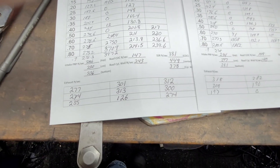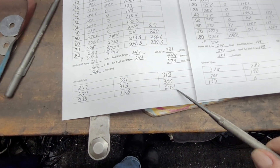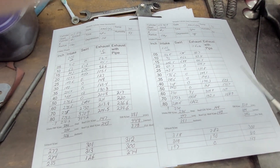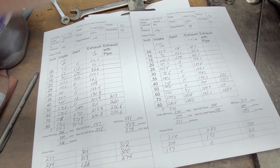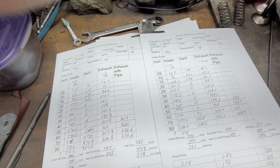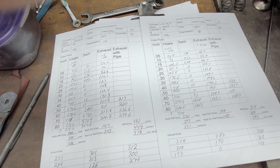The speeds are actually quite a bit better than the stock speeds - the stockers are really really low. This picked up quite a bit. The center is not completely dead and went up quite a bit here. So as ugly as that exhaust port looks, it's a huge step in the right direction - 158 to 201 CFM, that's 42 CFM - not bad, but we can do better. I'm actually going to do a little measuring and grinding on these, and hopefully get to reflow at least one intake and one exhaust for you guys in another day or two. Thanks for hanging out watching this - a little Mopar action.